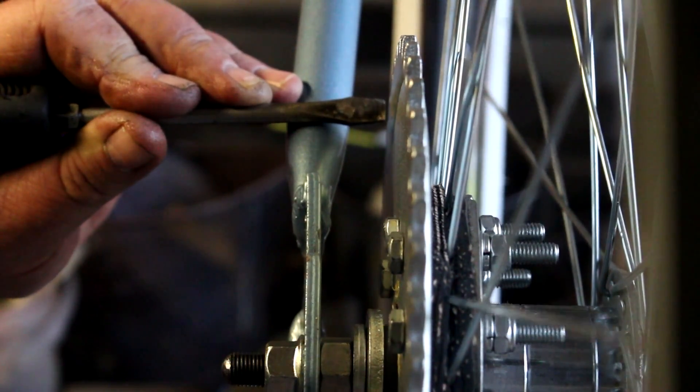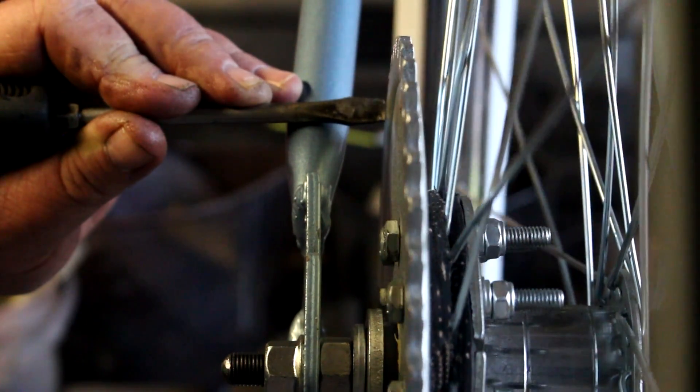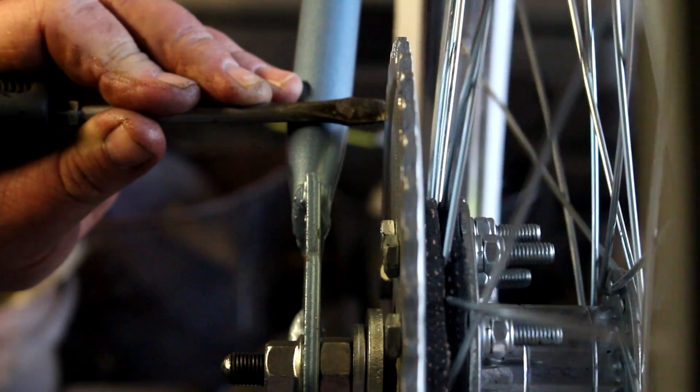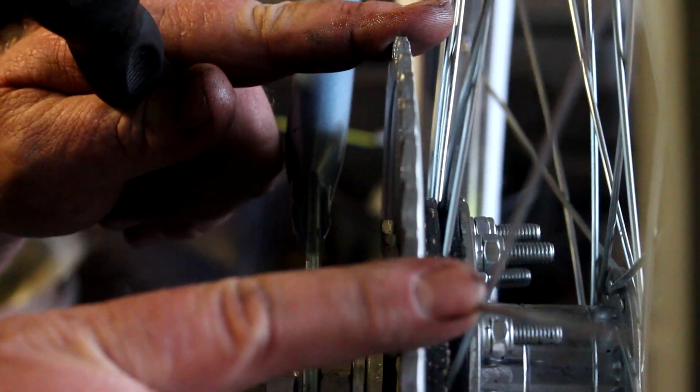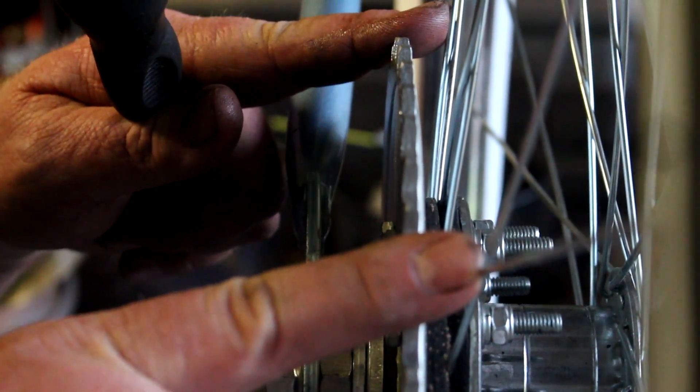About an eighth of an inch is about all you're going to get away with. I'm starting to rub, now I'm not rubbing — I've identified three spoke intersections where I need to tighten up. It's out for about three spokes' worth.